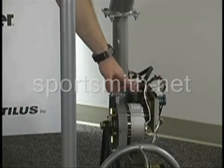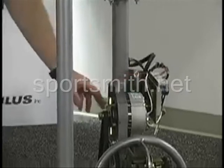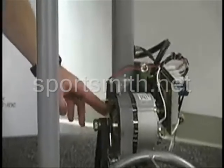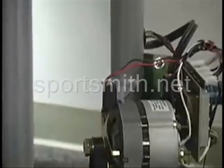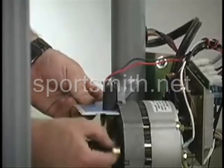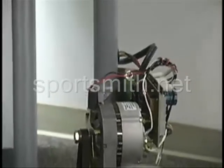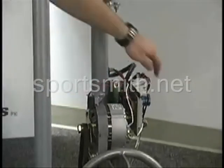If you verify that your battery voltage is good, then you want to take a look at your speed sensor. The distance between the speed sensor and the speed disk should be about a business card's thickness. As you can see here, it's very close. If your speed sensor is gapped out properly and plugged in, then the next component you'll need to look at is your lower control board.